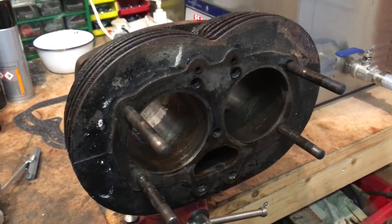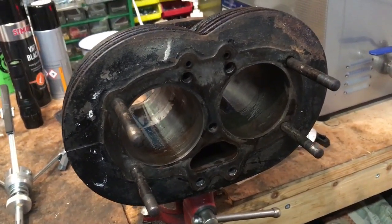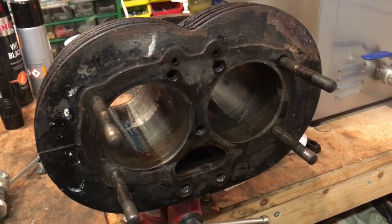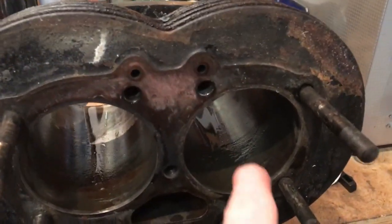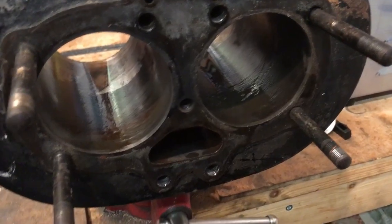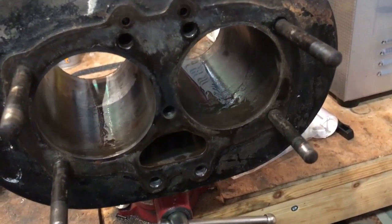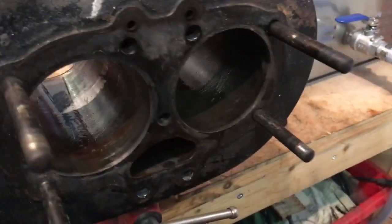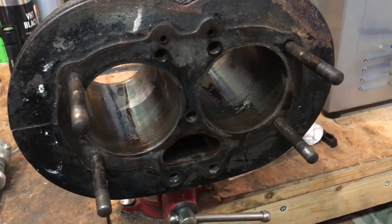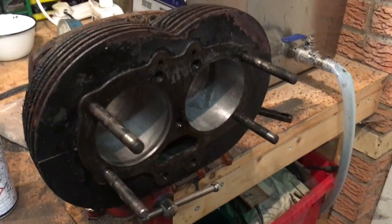Barrels cleaned up, degreased and clean pretty well. I'm going to give them a light honing just to see if there are any aberrations in the bores. Generally still looks pretty good, but there's something in there on the right bore - I think there's a low spot where maybe in the past piston rings... you can see it there. I don't think that's going to come out at all, it's quite deep. So we may be looking at a rebore on this, but going to give it a light hone and do some other prep. The ultrasonic cleaner is on; we'll give it a good clean and see, but it looks as though we might have to bore them out.